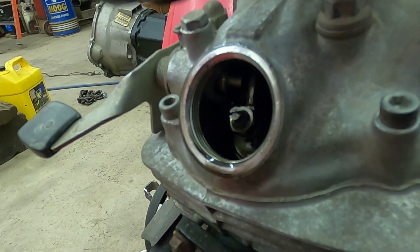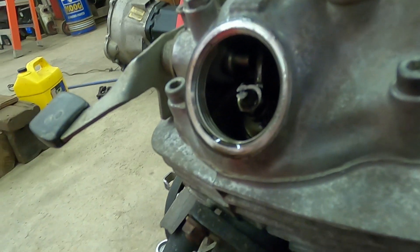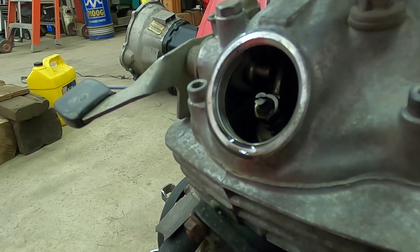So the way I'm going to do this — this is the exhaust valve I'm showing you right now — we're going to watch this and I'm going to roll this engine over by the pull starter until it just barely starts to open the exhaust valve. The exhaust valve actually went a little bit farther than I was hoping for, but now that our exhaust valve is starting to open, the intake valve is at a point where it can be set.